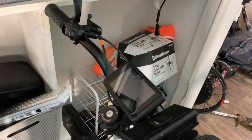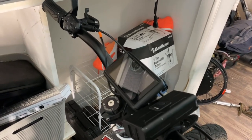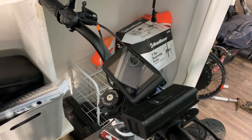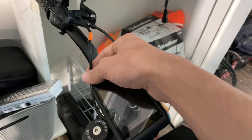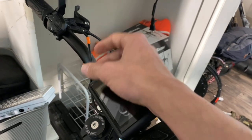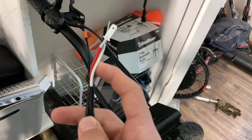Here's my e-bike — although it might be a lot more powerful than your average e-bike, it has one similarity with basically every other e-bike: it has some sort of button which hooks up to a screen, which hooks up to your controller, which turns on your bike. As you can see, there's a wire which comes from this button control panel to our screen, and essentially what we're going to be doing is splicing into this wire — specifically one of the smaller wires inside of here.